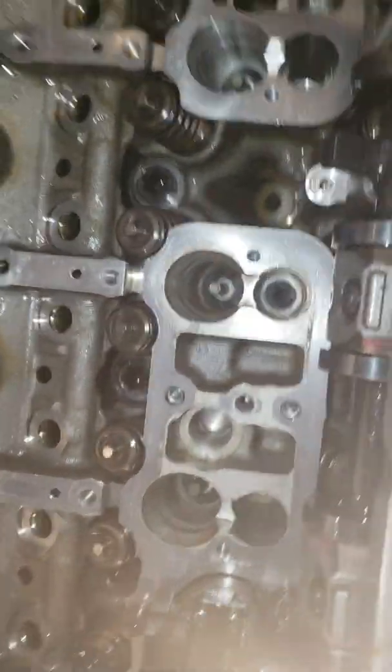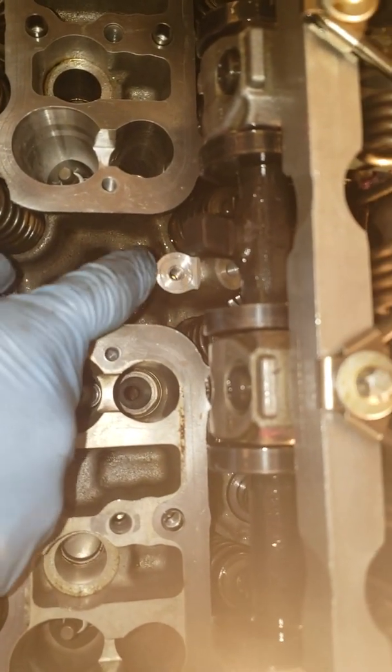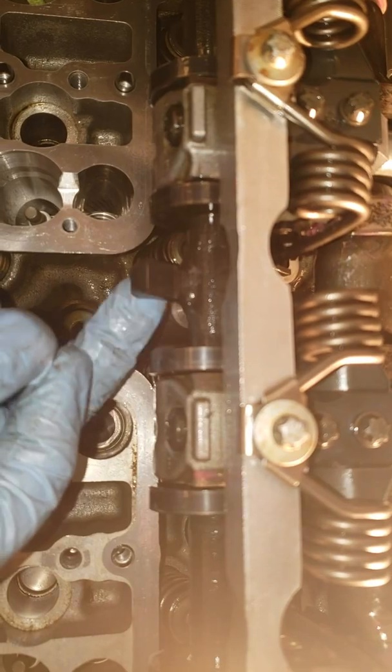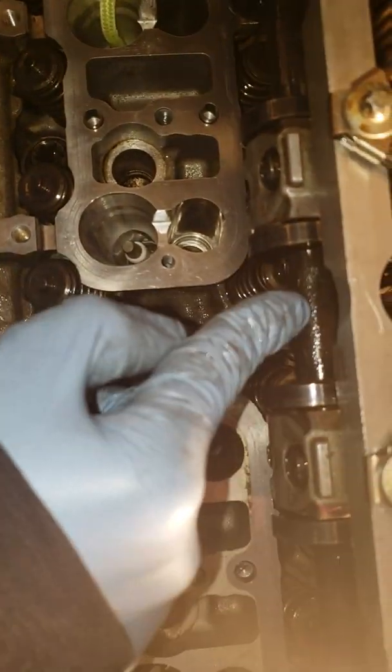If you let go of this allen key, do not keep going until you understand this. You drop the allen key through and rotate it clockwise — maybe 10 to 15 turns to get all the way to max lift. There's a flat spot on the lobe so it should sit there at max lift when you finally get there, and you won't have to worry about holding it anymore. But until you reach max lift, do not let go — that spring tension will cause the eccentric shaft to whip back to minimum lift. There are stoppers here, and if you let the tension go, you can end up snapping a stopper off. Then you have to remove the valve cover, replace the shaft, and it won't be cheap or easy.